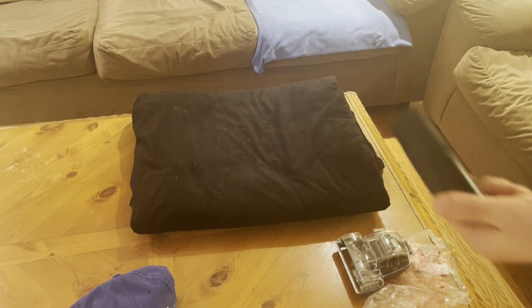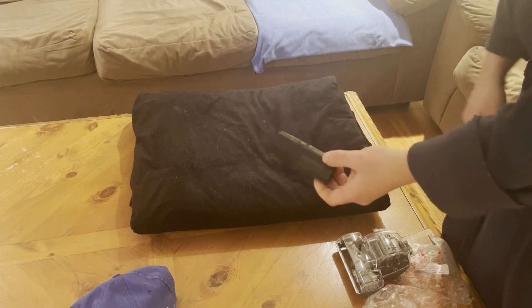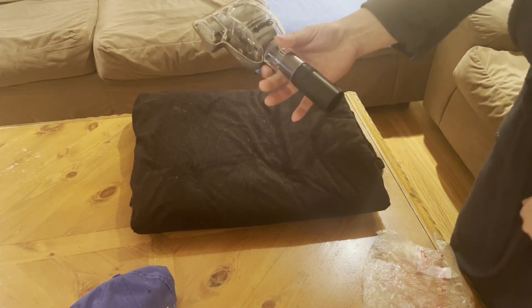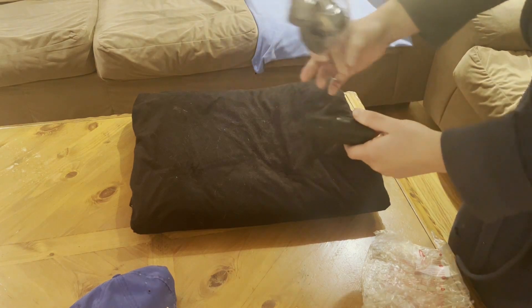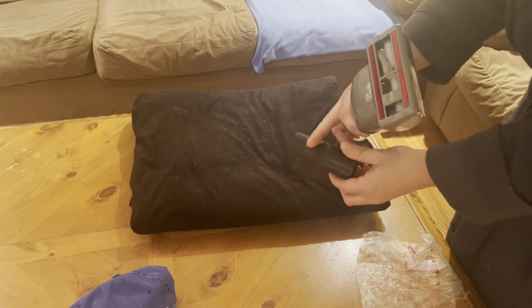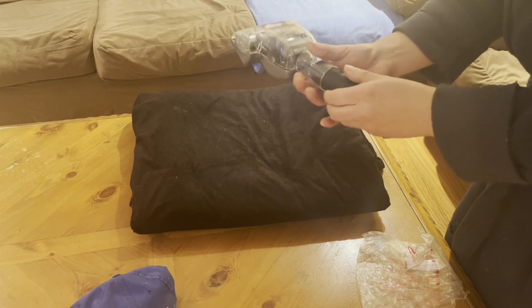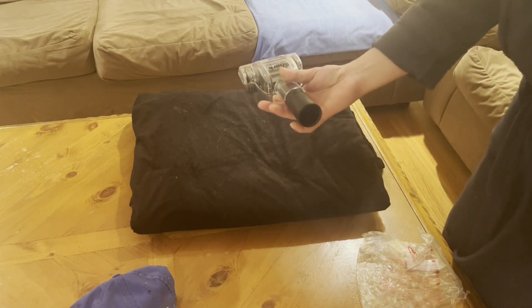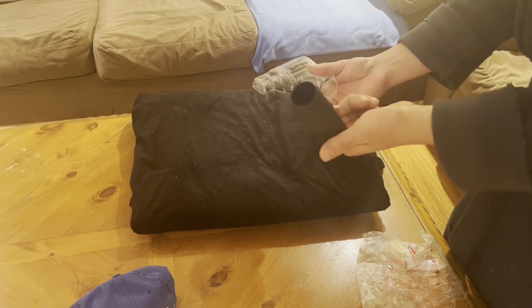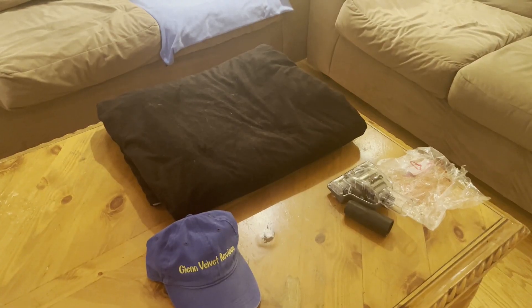I got this attachment from Home Depot and had to make the fitting myself because Shark is a pain — their connector size is non-standard. It slips right in like that. I used a grinding stone to grind it down, then made it very soft, then used a heat gun to make it even softer so it fits snugly. My mom can just connect it easily. I got the fitting from Lowe's or Home Depot for a couple of dollars.